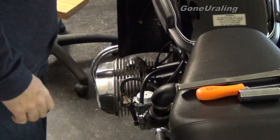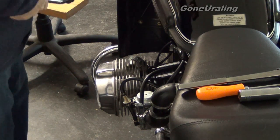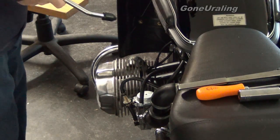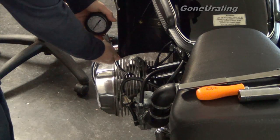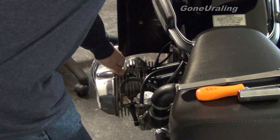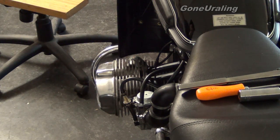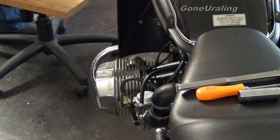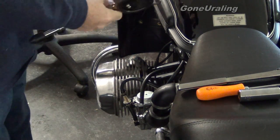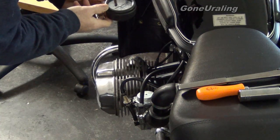Okay, we'll do a quick compression check. I took my hand covers off — they were in the way and kept hitting me in the head. So we'll do the left side first. Just do a pressure fit there, hold that in. So the first thing you do after you do a compression check is go find your reading glasses so you can read. Eyes are just getting old — not that I need these, these are for style. Okay, it looks like we're just below 125.